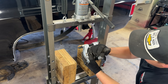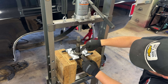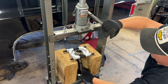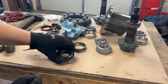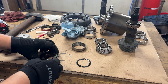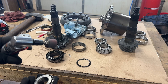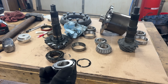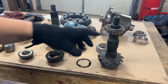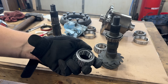Over to the press with a bearing separator — it goes between the bearing and the pinion gear. We want to make sure we're grabbing the actual inner bearing and not the cage. There it is — the old pinion, and our one single shim. We'll grab a measurement on that. Now we're going to make setup bearings: I already did the outer bearing using a die grinder with a drum sander, wallered out the inside until it fits on the pinion gear. This way, when setting everything up, we don't have to press the actual bearing on and off a hundred times — we just slip these on, set everything up, and press on the actual bearing for final assembly.